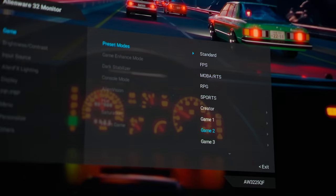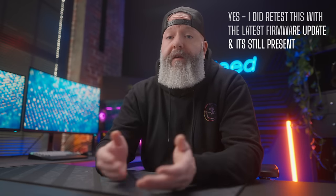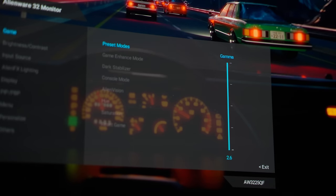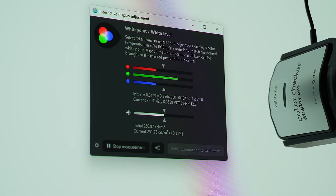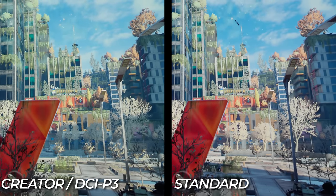I have some weird behavior on my copy of the 27-inch where sometimes it hits max SDR brightness in the high 250s, and sometimes it just maxes out at around 220 to 225. I never saw this on the 32-inch, so it could be a small firmware bug or just my copy. Either way, 220 to 225 is still plenty bright. The Creator mode is really consistent — set gamma to 2.2. For gaming or watching movies, DCI-P3 is the way to go for wide-color gamut and nice saturation, though the white point at 5,800K skews a bit green on both monitors. For content creation needing accurate colors, sRGB mode with its 6,400K white point is the better choice.